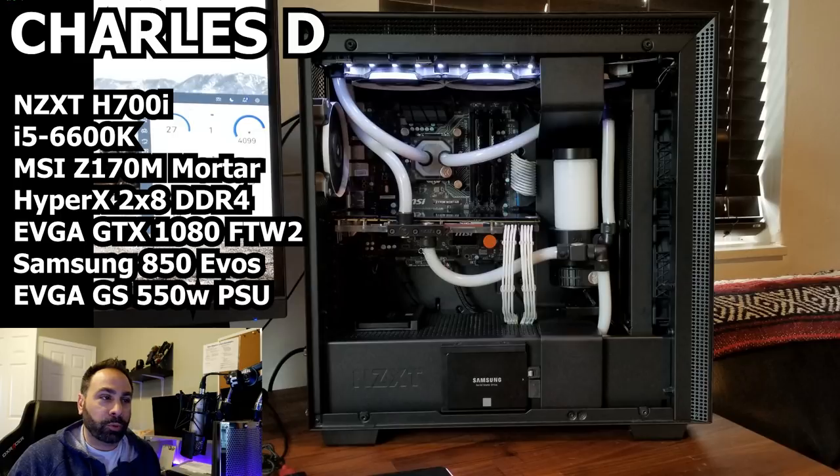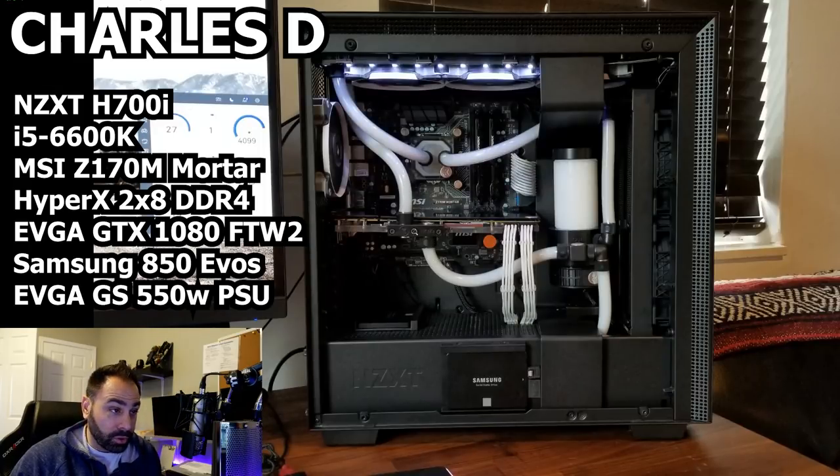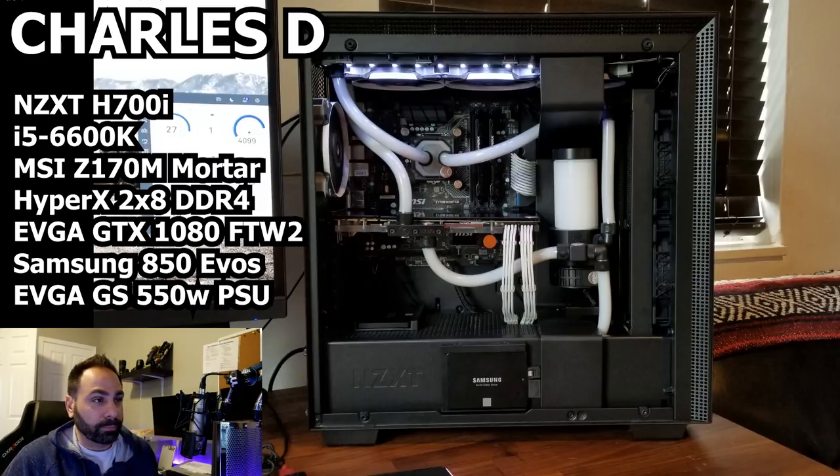The thing that concerns me just the tiniest bit is that this fitting here and this fitting up here — the angle of the tube going into the fitting looks a little cockeyed, a little crooked. The reason is he wanted to use as short a run as possible, which is what makes systems like this look neat. However, you don't want these to be angled because it's putting undue pressure and strain on the fitting — I have done this where these have popped out over time. The tubing relaxes after a while, loses its elasticity and grip, and the tubes can pop out. If you do any system maintenance, maybe cut a piece of tube about one centimeter longer so the entrance into the fittings is vertical — it goes directly down into the fitting and this goes directly up. Alternately, put a 90-degree fitting on here and have the soft tube come straight out of it.